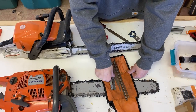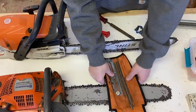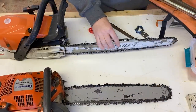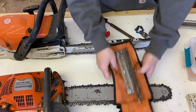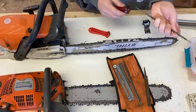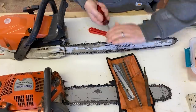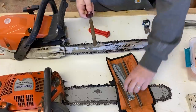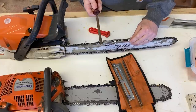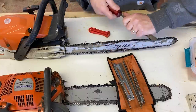I've used a ton of different things over the years to try to keep chains sharp — it's always been my biggest struggle. I originally went out and bought this little kit. It has gauges that you'd mount on the bar and line up just right, with a handle that came with it. You'd select the right file, stick it in, and file your teeth out in the gully. Then you'd switch to your flat file and clear off your depth gauges or rakers. This worked pretty good and helped me keep things working pretty well.